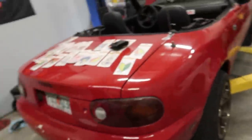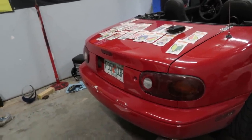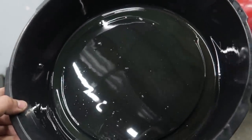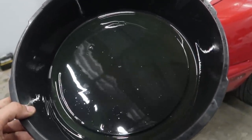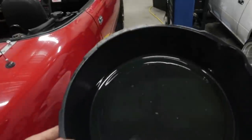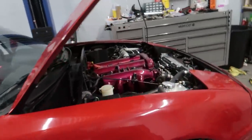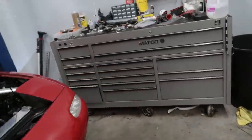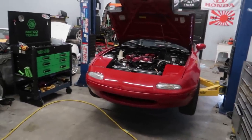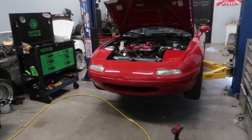This is what you need to do after you weld a diff, because you're always going to get some splatter in there. After a bit of driving you change the oil, and you'll see all those little pieces of metal — that's just splatter that's come loose. Now that we drained that out, I put some fresh oil in and it's all good. Now I'm going to move on to the front — we need to change the bearings and the hub as well, so I'm gonna smash those out real quick, set up a time lapse, and let's get this done.